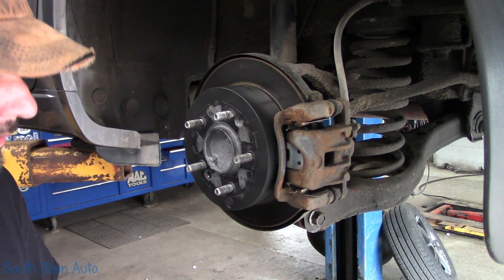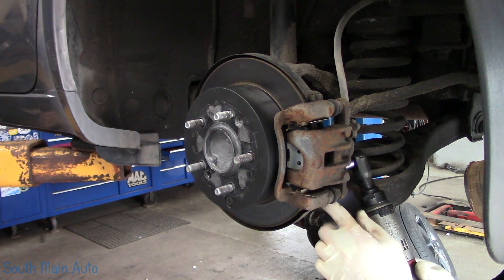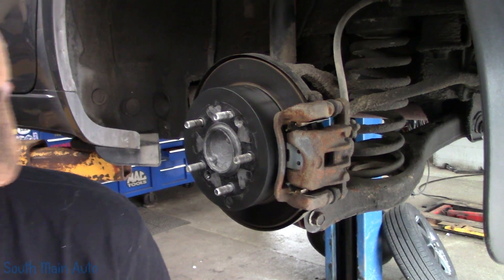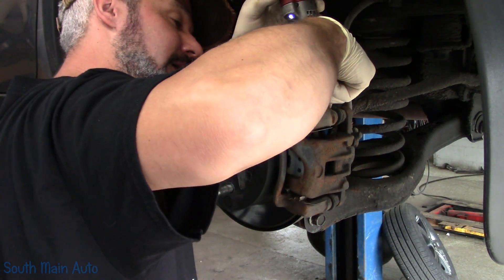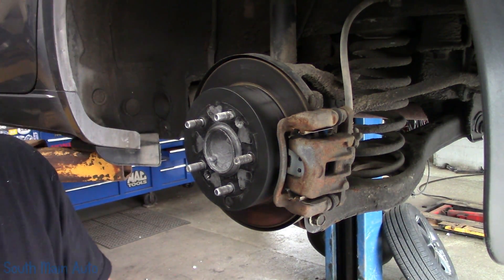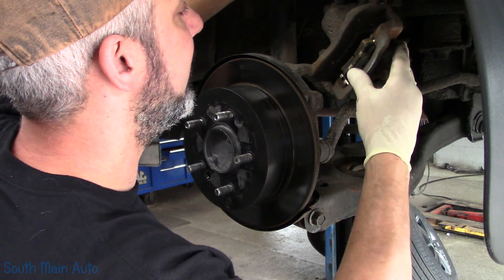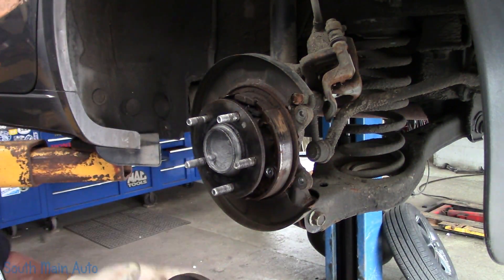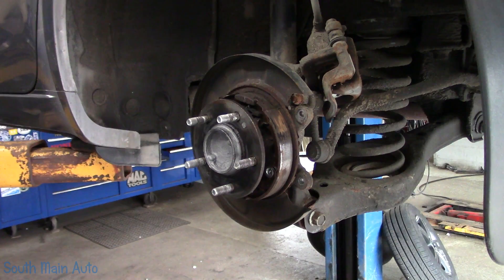Now the pads on this are not that old. We've got a flat and a lock washer on them. Now we'll just pull our caliper off. If you need brake pads, now's the time to do that obviously, but these ones are not that old so we're just going to leave that set to the side. It just slid right off. Pull our brake rotor off. Now we're going to take and clean this out — it's got a lot of brake dust and goop in it that we don't want to get on our new shoes.